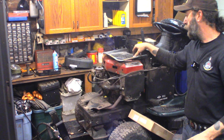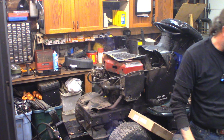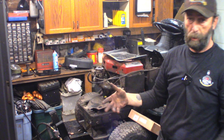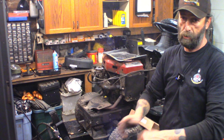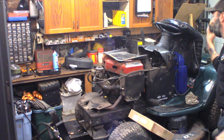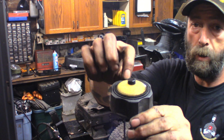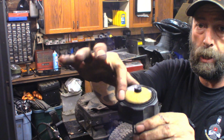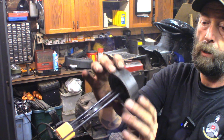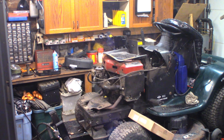I don't know for sure but I have a theory that the water comes in through the fuel cap. The fuel cap on these is under the seat, and of course you flip the seat forward — so it doesn't get beat on by the sun and destroy your seat — but then when it rains on that gas cap, I think it makes its way in either under the vent, or it could be leaking in around the edge of the level gauge itself. I don't like this style, but it is what it is.